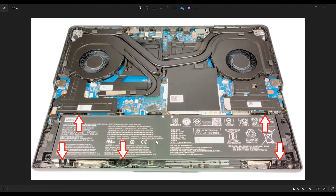After taking the screws out of your battery, there's the battery plug right here. Some of you may see a black piece of tape on it — just peel that back and you'll be able to wiggle that out of the port. As with most things in a computer, try not to pull on the wires if you can help it. Put your fingernails on either side of the plug, or use a pry tool, and wiggle it out of the port rather than pulling on the wires.